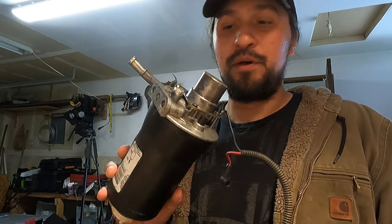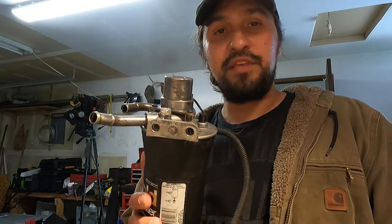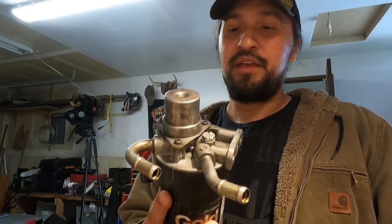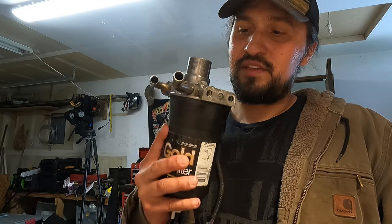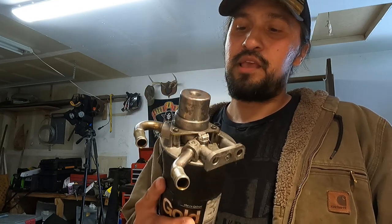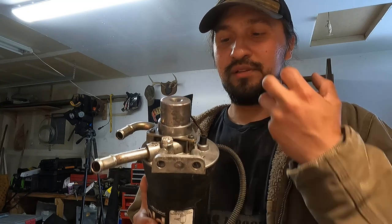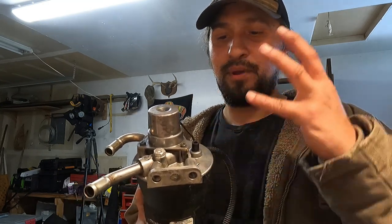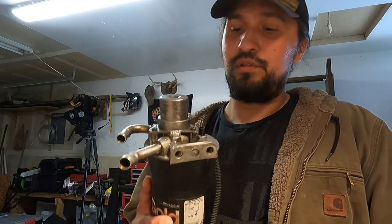Most people, once they have a lift pump, don't need the heater, so they delete it, because these things are known for leaking. Notorious for leaking. Everybody hates them. I'm not a huge fan of them myself, just because it seems like a poor design, especially if you have a heater in there that works, which this one doesn't. If you have a heater that works, it just cooks those O-rings. It's under a lot of pressure and things melt, so your O-rings will fail on you. So most people just delete them and they're done with it after they have a lift pump.